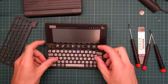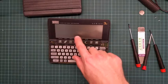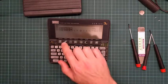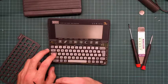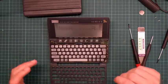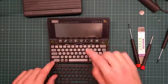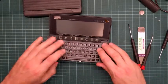Let's put the keyboard on, power on, and make sure this boot works. I can see the screen is divided into two - the bottom is not working. Let's now push the mysterious button and see what happens. It went blank - it's a hardware off button, that's all it is. If your machine goes nuts and stops responding to the normal off sequence - which is Function-1 - then you can push that and the machine shuts down. It's probably even in the manual, which I actually have somewhere.